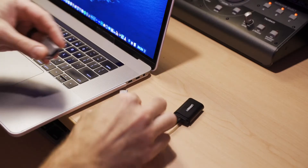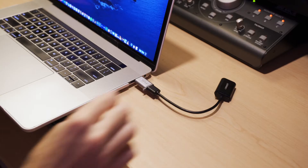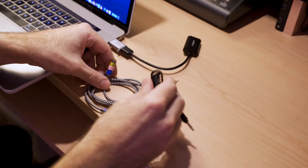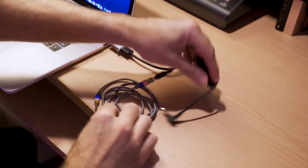It's really meant for smartphones, if you can find a smartphone in 2020 that still has a headphone/mic jack on it. So put it away and save it for later. Now we'll take our Ugreen USB mic adapter and plug it into the laptop. For my MacBook Pro, I have to use a USB-A to USB-C adapter, but this option still provides power to the adapter. And having the USB-A model gives me more options to plug it into different or older computers if needed. Take either the included cable or the additional cable that hopefully you purchased. In my case, I have a 1/8 inch extension cable that is male on one end and female on the other, so I just use the included TRS coiled cable first, then use the extension cable to make the cable longer for more flexibility.